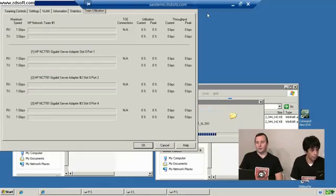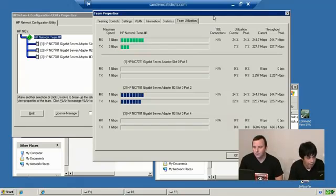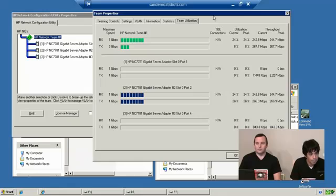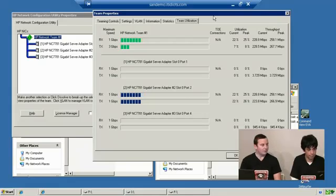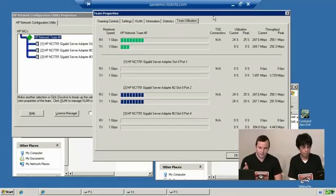And what you'll see on here now, look, it's TOE connections. That's what you were saying earlier, isn't it? TOE connection, not available. So the software understands a TOE connection, but the network card doesn't. What you can see here as well is that the iSCSI is reading in and writing back to itself over the network card, and on this particular occasion it's coming in and out on the same card. However, next time you do it, it may come in on one and out on another. But what it's showing is, in this configuration, it will only ever use 1 gig.